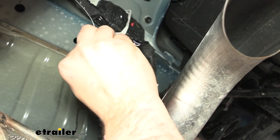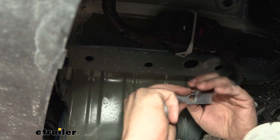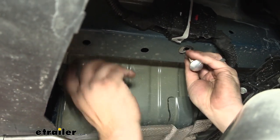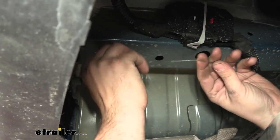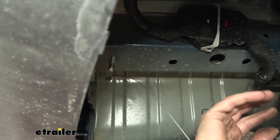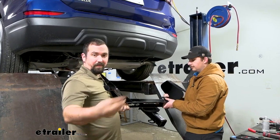If needed, put a small bend on the tail end of the wire so it doesn't pull through the hole and helps when feeding it through the hitch. Take your spacer block and feed it up into the frame rail, then thread the carriage bolt onto the coiled section and feed that up into the frame rail as well. As you pull the wire it should drop into place — you may need to wiggle it a little. Leave the fish wire on to help with hitch installation, and repeat the same process for all remaining holes on both sides.